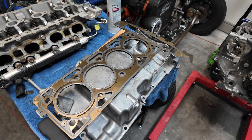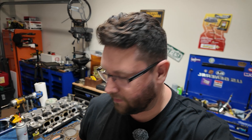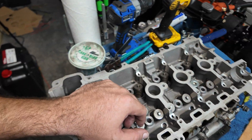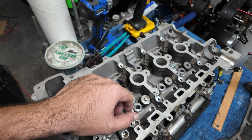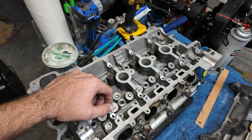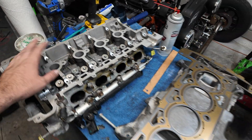We got the right gasket directly from GM. I'm a big GM parts guy, especially on electrical stuff. Didn't hot tank this, didn't really do any of that. Got it cleaned up with a razor blade and some brake parts cleaner, and it's going on as is. The bottom end is clean. We'll take care of the top end when we're ready to drop the cams in.